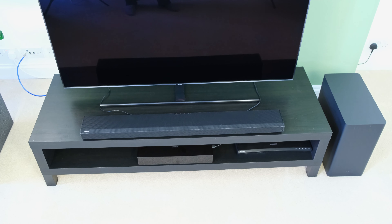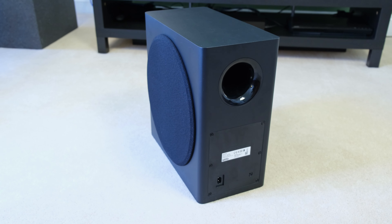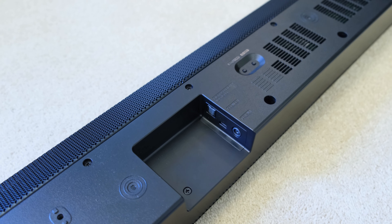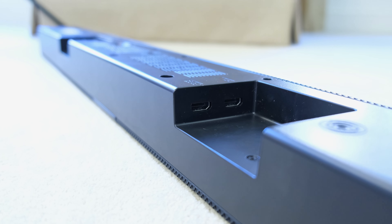Continuing with wireless connectivity, the soundbar also has Bluetooth, although it's limited to the lowest quality SBC codec, so you'll probably want to resort to this only if you're not doing any critical listening. For the best sound quality you're going to want to plug it in — you've got optical and HDMI to choose from, the latter being better — and you've also got HDMI ARC and eARC support. eARC is definitely appreciated specifically if you're listening to Dolby Atmos or DTS:X content, because you get uncompressed metadata. That said, if you're not consuming that content, you can still use ARC and it's definitely backwards compatible.